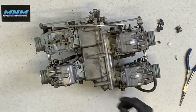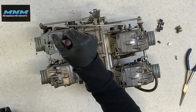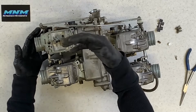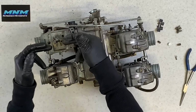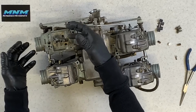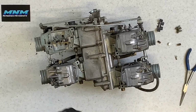To finish putting this bottom back together here, you do have your pilot jet, which is in here. Take a flat screwdriver, pull that out, clean it out, blow through those orifices there. Oh, what I wanted to show you when that top cap was off, which we've already done, you want to make sure that you blow through these orifices when that top cap is off, so you don't damage any of the components up top here. You don't blow that needle to a position that it shouldn't be. Blow through those orifices while that top cap is off.